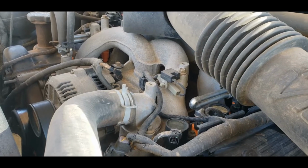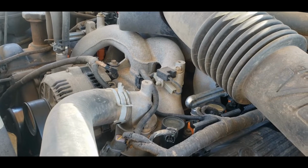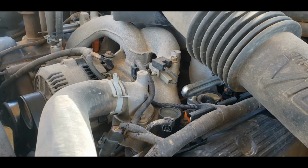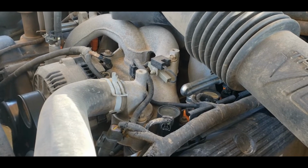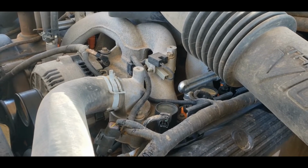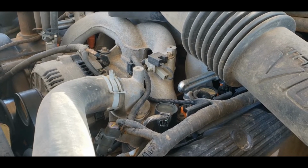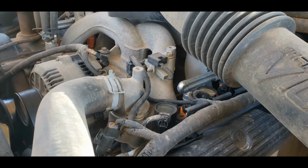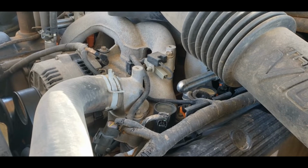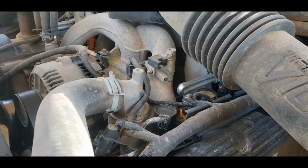So there's a whole procedure on being careful and taking them out. And then if they do break or they stay in there when they're not supposed to, if they take a chunk of the head with them when they come out, because these are aluminum heads on an iron block, because Ford thought that was a good idea for some reason. I don't know why. But since aluminum is softer than iron, if you're not careful, you run the risk of pulling a chunk of the head out and essentially stripping the threaded part out for the spark plug, so you'll never get a spark plug back in there, which is what I meant when I said these don't like to come out when they're supposed to come out.